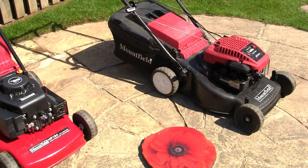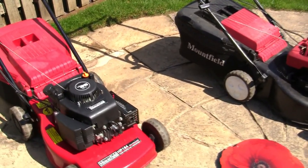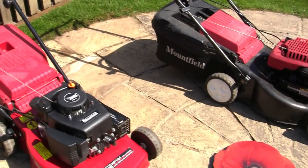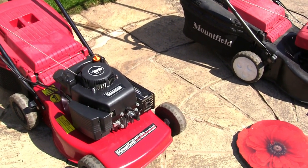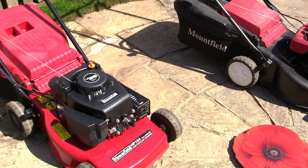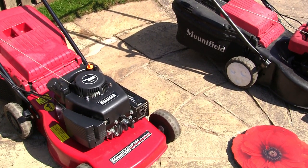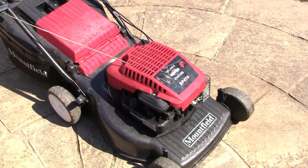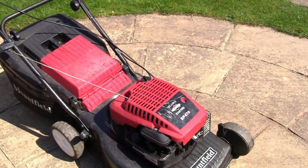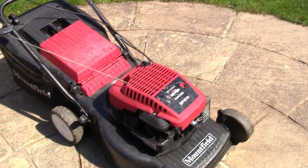Right, next tip. The next thing I'm going to talk about is the ignition coil. Now, I hear a lot of people saying, when I go to auto jumbles and lawnmowers are being chatted about, they say, oh, the coil must have gone. I think I've done probably 2,000 lawnmowers in the last 10 years at least, and I've had one bad ignition coil. So for that reason, I'm not even really going to show you the ignition coil, although I will show you how to set it. I will leave a link in the description again showing you how to set the gap between the ignition coil and the flywheel if you want that.